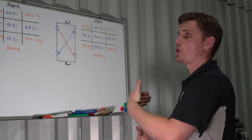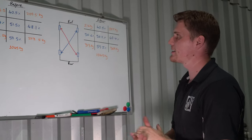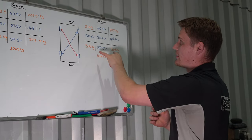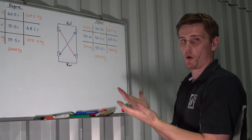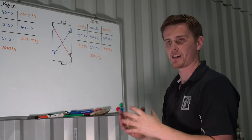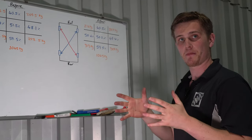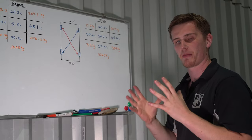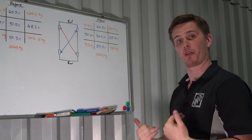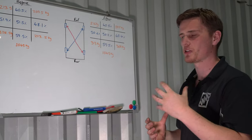You might notice the front is now nine kilos different, whereas before it was only four kilos. That's a conscious compromise. We're more interested in getting the rear difference down from 34 kilos to what we now have - just four kilos. On throttle, the car now has much more even traction at the rear tires. A nine-kilo difference across the front won't give drastically different performance under braking, whereas 30-odd kilos at the rear would have given drastically different grip levels on throttle. You have to find these compromises based on the platform and usage of the car.